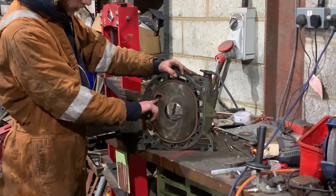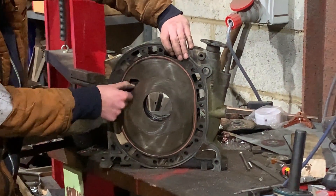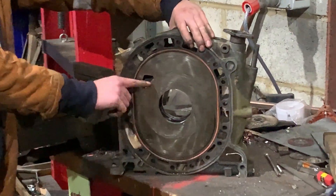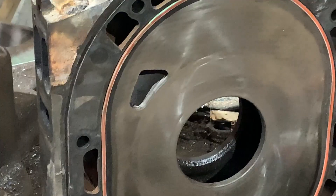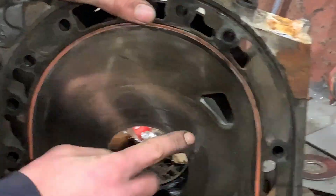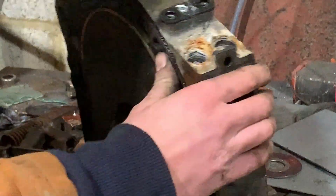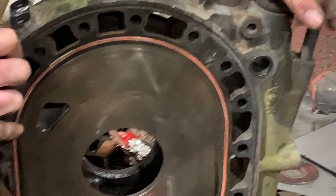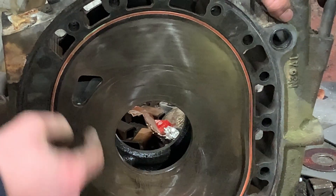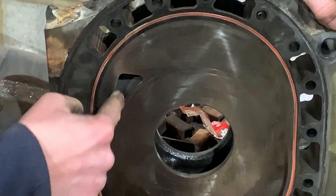As you can see from the factory, the machining isn't even that great. On this side there's a bit of a line and it's not even straight — there's a bit poking out here. On this side it's completely smooth. Factory ports aren't that great. Lots of people that do OEM plus just move them out and get rid of the castings, because there are sharp edges that will hinder airflow, which you don't want.